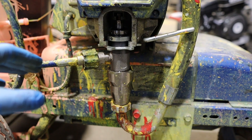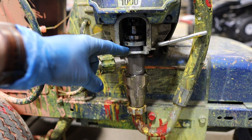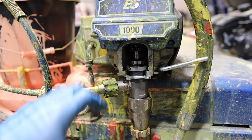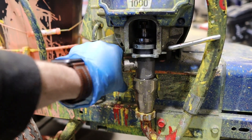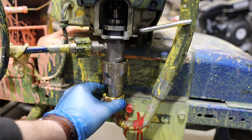To service this machine and change the pump, there are only three things we're going to do: release the collar just at the top here, take out the siphon hose, and then the return line on here as well. These literally just twist off — they're hand tight. As you can see, we can just turn them straight off. Same at the bottom — just a nice hand tight fitting.